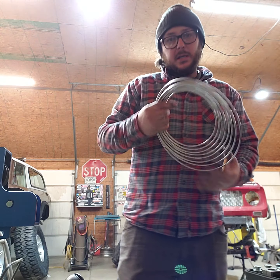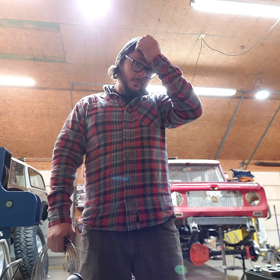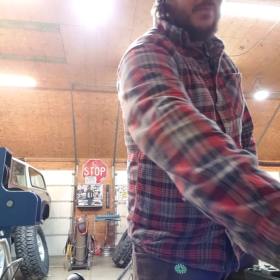I'm a snob when it comes to a lot of things — brake lines, electrical wiring. There's a few things that I really try to take pride in, and things I can't stand when I see people do a poor job at, just because there's no real excuse. This is stainless line. I don't always use stainless — I've been using a lot of the nickel-copper blend brake line lately. It's really nice stuff, low corrosion, probably no corrosion. I used to use poly armor, that was basically all that was available. The rest of this rig, believe it or not, I did put a stainless kit on it, so I'm making those back lines out of stainless also.